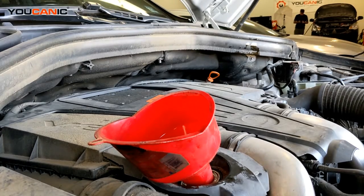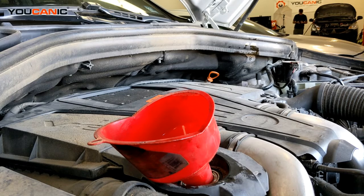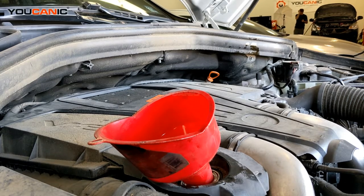Then take the engine oil. This engine is recommended to use 0W40 engine oil. We're going to have the specifications that it has to meet in our tutorial, so just look for that. Yeah, this engine does take about 9 quarts.